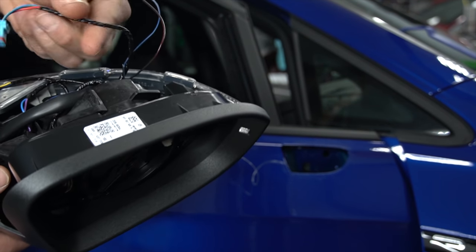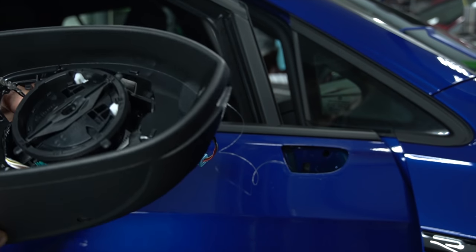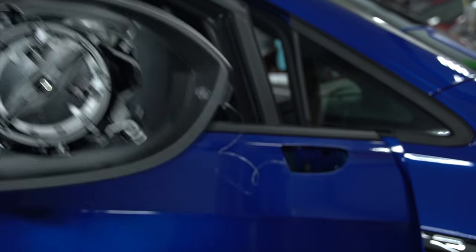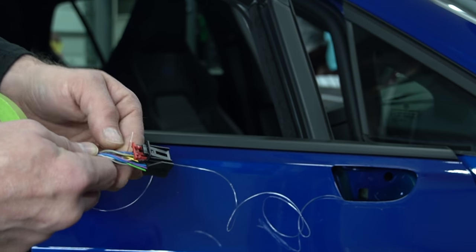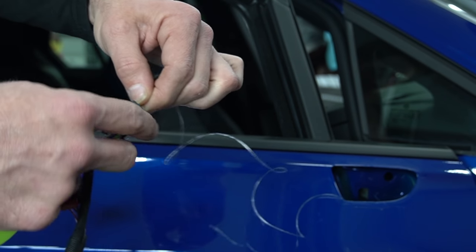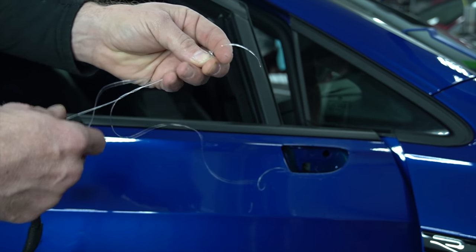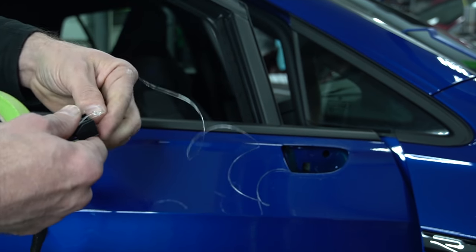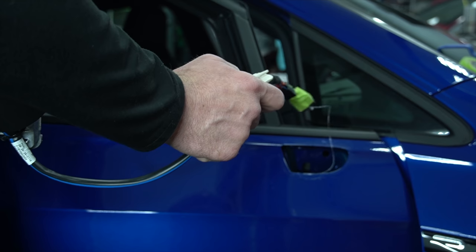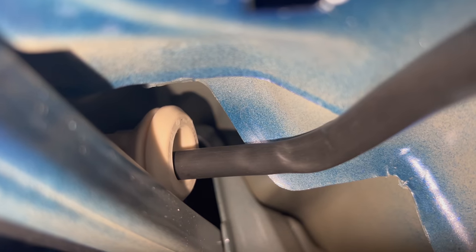Get this mirror gone and get the new power fold mirror in — which really other than our tape looks exactly the same. Make sure we pull our connectors out. This is the one that goes to the blind spot flashy, and these two are for the heaters, which should go out here. You want to make sure that you have them accessible so they're not buried down in here after you put the cap on. Then we're going to take our wiring harness — I found if you run that fishing line through the connector like this, it's so much easier to get the connector through the hole. Just make sure it's on there. Pull it through — make sure it doesn't separate — and make sure you feed this wire back through correctly.